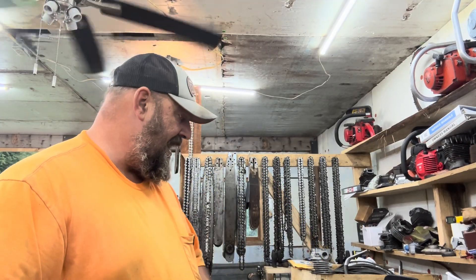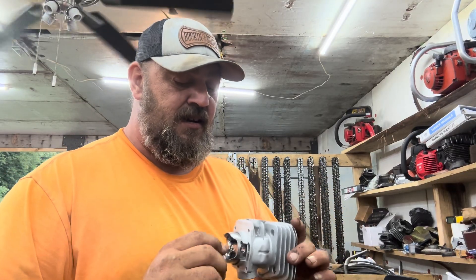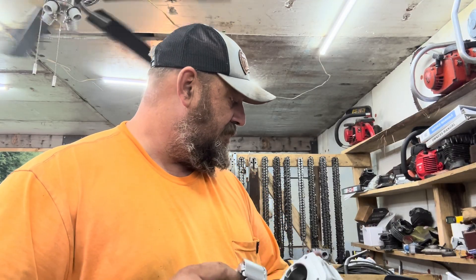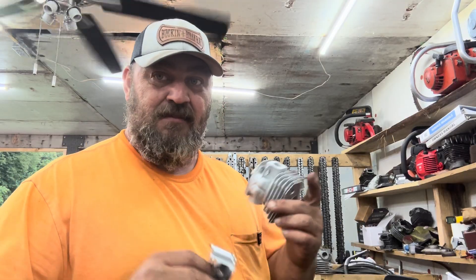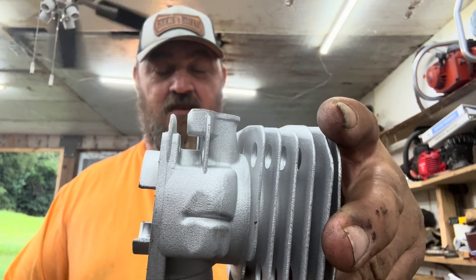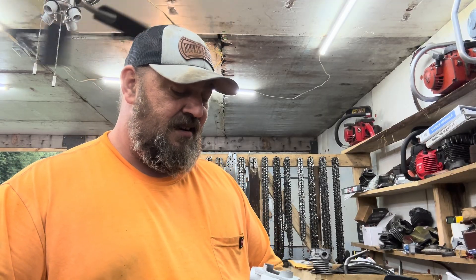If you've got the alloys and stuff you can get a little more precise, but that's how I'm doing it — by hand. This evening I'm probably going to go ahead and get set up to make this chamber cut, and then probably by the end of the week I should have all the chamber work done including the piston, at which point I can start doing the port work and put it back together. I'm not even going to look at the numbers right now — chances are I'll have that much machined off, probably down to that one fin right there, maybe even further by the time I'm done machining.